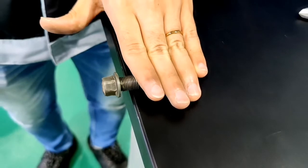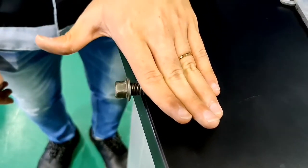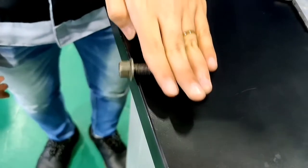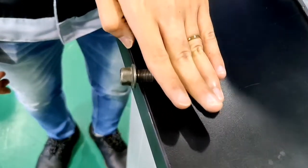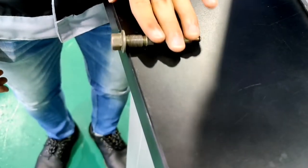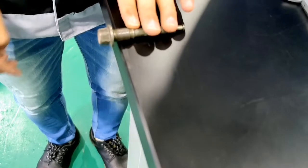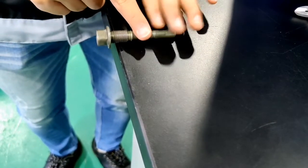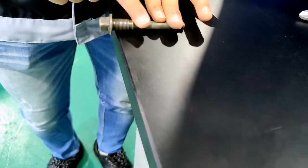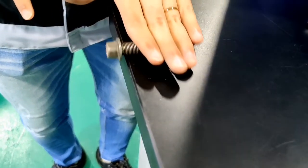Procedure to determine straightness of slide pins. The function of the pin is to guide the proper angle at which the brake pad meets the disc. If the caliper is not free to move, the caliper might be bent or the guide pins binding. Then slide the guide pin. If the guide pin moves in a perfect circle, it means the guide pin is in good condition.